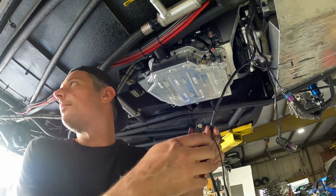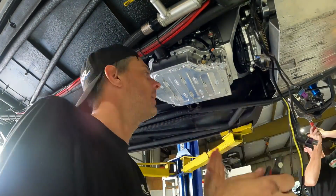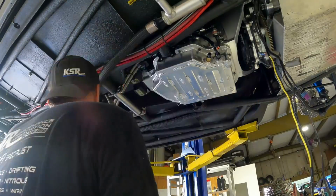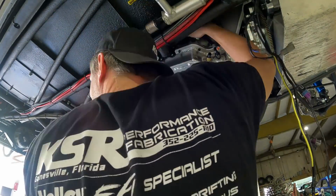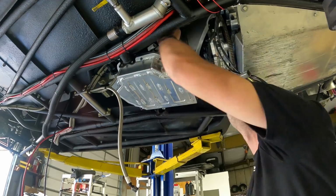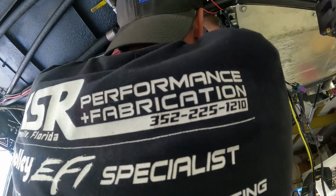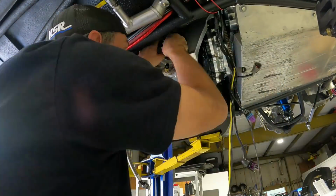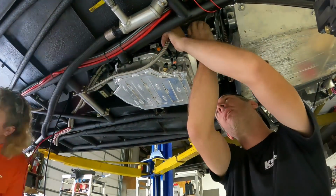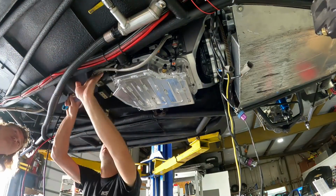But one of the bad things about doing really nice heat shrink wiring harnesses is that if you have to go back and change anything, well, you have to cut off all the heat shrink and kind of start over again. And on a Power Glide transmission, the trans brake solenoid is around the backside of the driver's side of the transmission, but in a Turbo 400, or at least this particular Turbo 400, it's internal in the pan, so there's a little short wiring harness that sticks out of the top of the passenger side of the transmission.